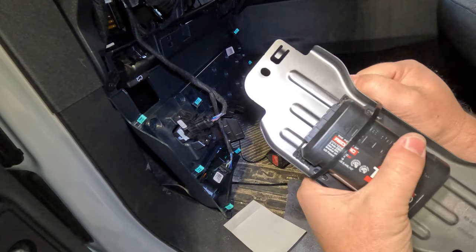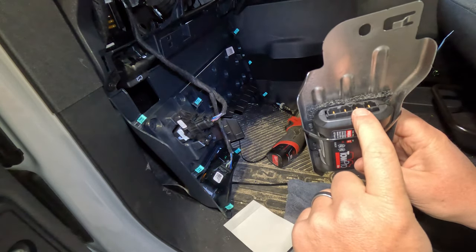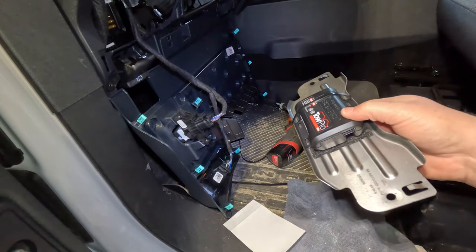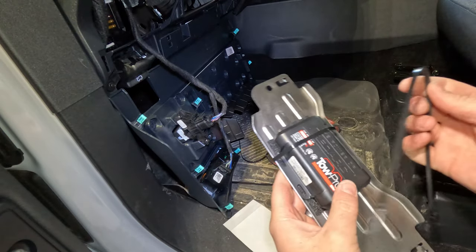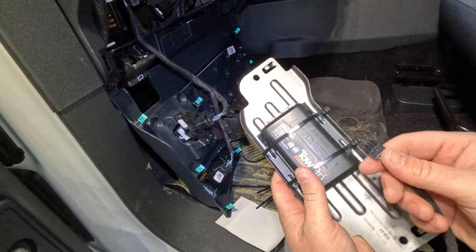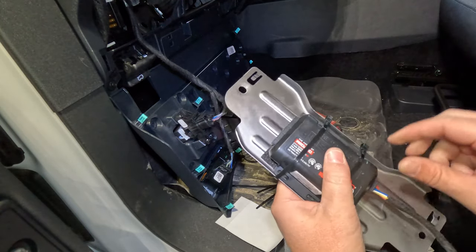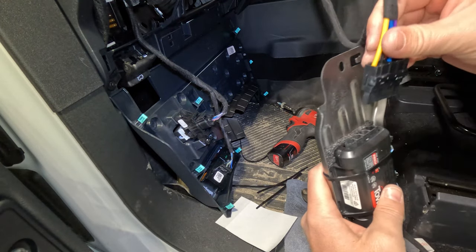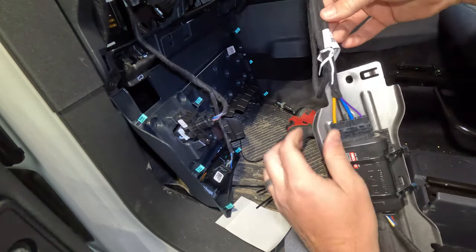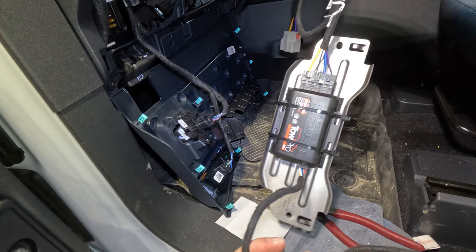Just coming in here with our zip ties now. We made sure to point this in the direction so this is going to go to our main wiring harness. This is going to go to our control knob that we just put in next to that light switch, so this one's pointing in this direction, this one's pointing in that direction — it'll keep everything nice and organized. So there it is all nice and snug, not going anywhere. So this one's going to the controller — now we're going to plug this one in, make sure you hear that snap and then check it. And here's our other one — that's going to plug into this side. We're just going to take these and coil them up nice and neat, make sure we only have the lengths we need, and put this back into place.